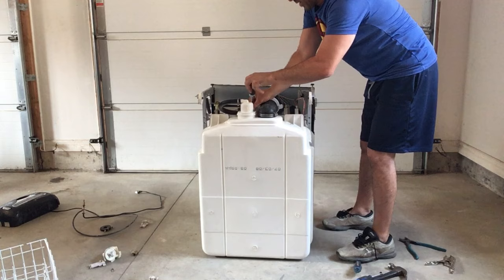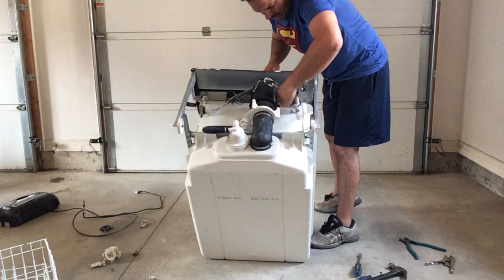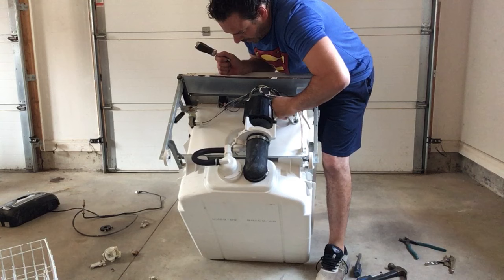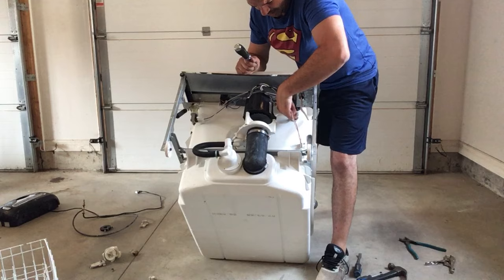The way to access the heating element is on the bottom — these are just a couple of screw-off knobs, two of them. I'm just going to unscrew them, and that is going to release the heating coil inside. There we go — just pulling it out. It should drop out now.